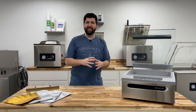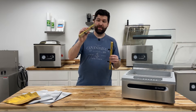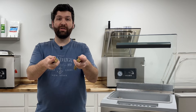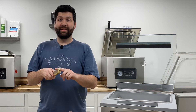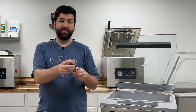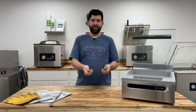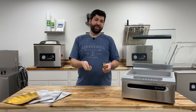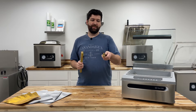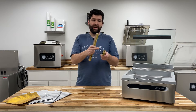Now we're going to go over basic identification between the retort bar assembly and the standard seal bar assembly that comes stock with your chamber vacuum sealer. The difference is in the heat strip — the metal strip that runs down the heart of your bar assembly. The standard seal bar assembly has a flat six millimeter heat strip, while the retort bar assembly has a three and a half millimeter concave strip. One quick way to tell the difference is to run your thumb or finger over the top: if it feels flat it's the standard seal bar, and if it has a little hill or nipple to it, that's the concave, meaning it's the retort bar assembly.